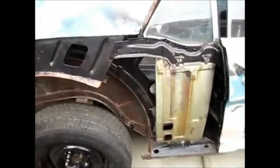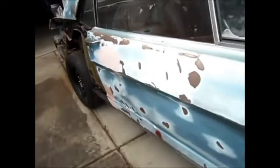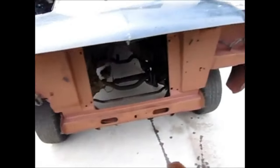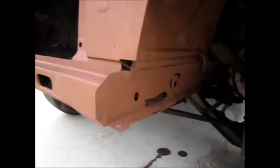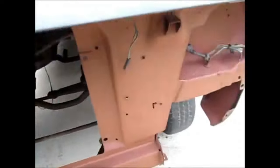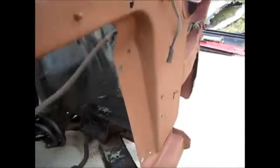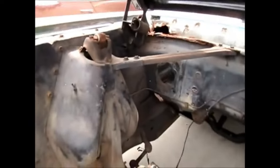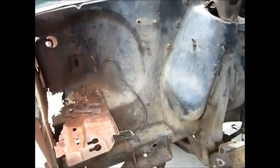I'm going to put two full quarters on it — that's one of the easy parts. The doors and fenders are all usable. Suspension's okay. Got a little bit of rust issues up here in the core support, which is an easy fix — you can replace those. I did a Mustang in the past that had some rust issues on this rail, and as you can see when I open the hood, it's got even more problems right there. But all that's fixable. The good part is the shock towers and even the apron areas are all in good shape. Unfortunately there's rust on the cowl on that side and on the cowl on this side.